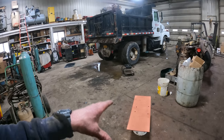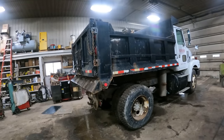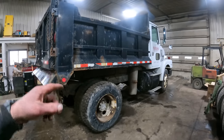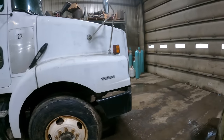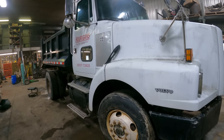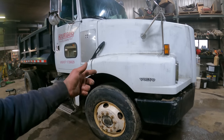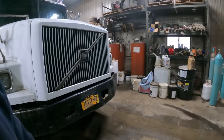We've got our bracket primed up and ready for paint for the C5. Nate's working on this little dump truck of ours — we use it to pull around the skid steer trailer and do a little bit of dirt work. We put front tires on it a while ago, and I noticed when Jared was hauling straw that them tires were wore right out again. I thought it needed kingpins, but when they brought it in, the kingpins were fine. However, the main tie rod going from one wheel to the other was bent.